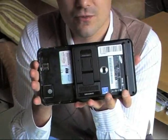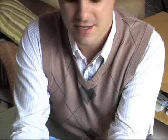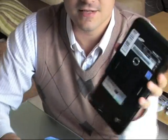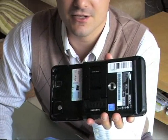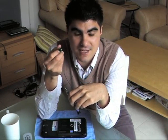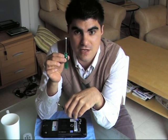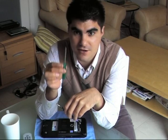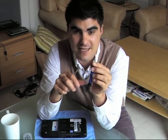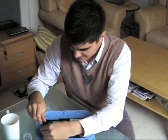Now we haven't actually got that much to do when upgrading the RAM. The first thing you want to do is take out the pen out of its harness. The second thing is you'll see an array of screws staring at you, so let's get rid of those screws. For the exercise today, what you're going to need is a Phillips head screwdriver — the star shaped screwdriver — as small as possible, one of those computer type laptop accessory screwdrivers, not as small as a watch battery type screwdriver, but definitely a small one. And a blunt, very soft edged flat head screwdriver, and I'll tell you why in just a second.